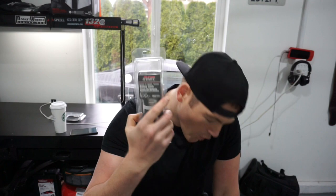So I'm assuming it's something to do with these grounds, and I hope that this helps. If you guys can comment down below, Mitch, whether that solid one is from factory and not aftermarket, that would be super helpful. Then I can know if I should connect that to the negative of the battery, the one in the chassis that I just showed you, and if I should connect another one from the 2ZZ to the firewall or to the battery. And then I think it's probably a good idea just to get a larger battery. I think it's just a better idea, more reliable. Those little batteries suck.